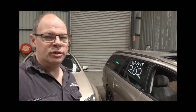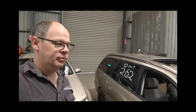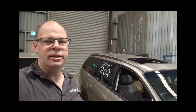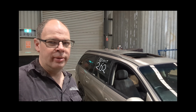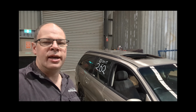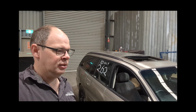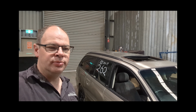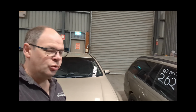I had a cracker day. I'd call it a success because, yeah, there were zero mechanical issues. Dylan has done a great job with the engine. So with the engine, Dylan did the complete cylinder heads. He cut all the valve seats by hand, old school. Like this thing's built on a budget, so whatever we didn't have to send out, we didn't. So Dylan cut all the seats by hand, assembled all the heads, filed all the rings, did all the basic assembly work. And the engine was faultless. Trans faultless. Hooked up great.